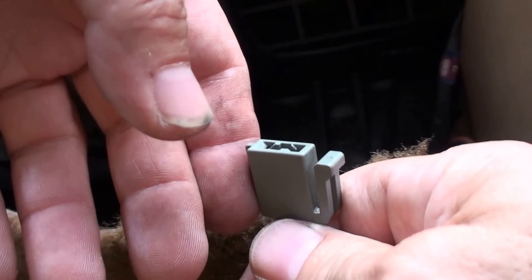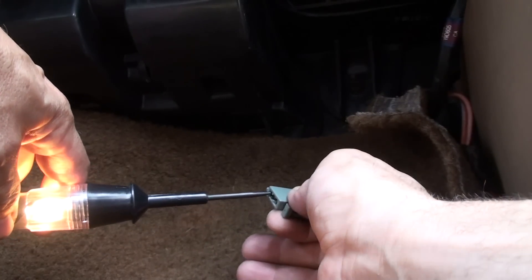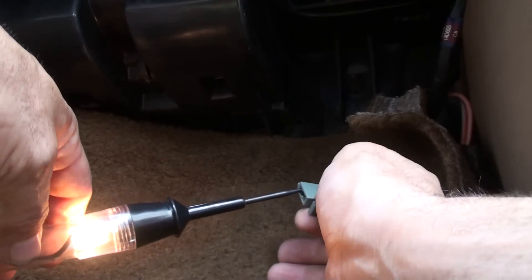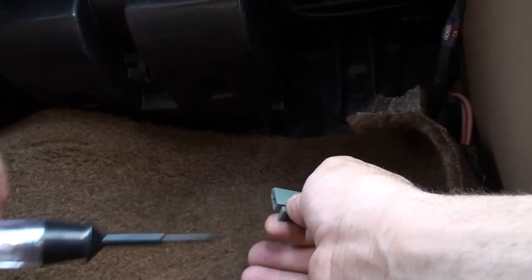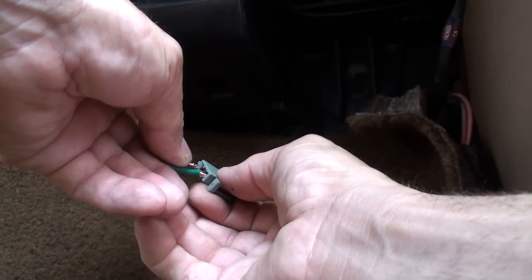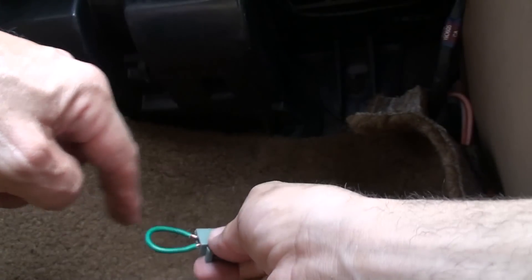Let's get the test light on it. Right now I'm hooked to battery positive and I am lighting up on that pink and black wire. This side is nothing - this is basically just a switch, just a jumper. So we have power here now. Let me jump this right now. I do have the relay plugged in. By the way, I did check the relay off camera - put 12 volts to it, it was clicking - and I did a continuity test on the control side, it worked fine. So now I've got this jumped with a piece of wire.